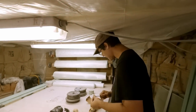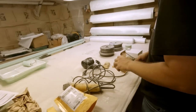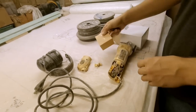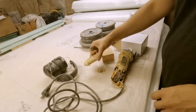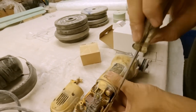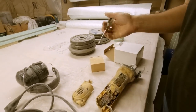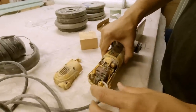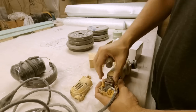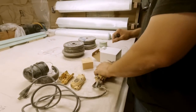What's going on over here - we got our spare brushes, or replacement brushes rather, for these grinders that have stopped working. I've already torn this open but the brushes are down in here. There's a huge buildup of hair and fiberglass and dust. I haven't blown it out with an air compressor yet but I'll do that first. We're just tearing this apart and I'm gonna replace these brushes.